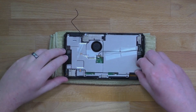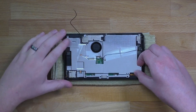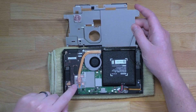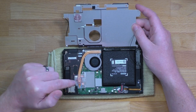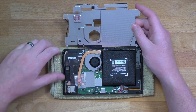This is just going to flip up and there's going to be some resistance because your first thermal paste is right here, but it's going to swing up and you'll see you've got thermal paste right there. This is a different type of thermal paste — I have just used standard to replace this and haven't had any issues, but just so you know this is a little bit different, it's a little bit thicker.